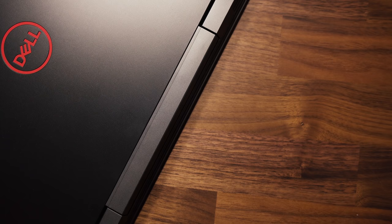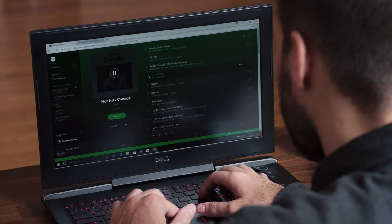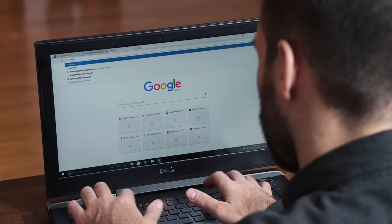The next big update is the GPU. Previous models used a GTX 1050 or a 1050 Ti. In this one we have a GTX 1060 using the new Max-Q design — so essentially you get a 1060 at a slightly lower TDP with a little bit less performance than a regular 1060, but still faster than a GTX 1050 Ti. At the end of the day you get a lot better gaming performance for a lot less power, which means better battery life and a slightly slimmer laptop.